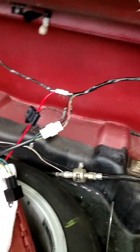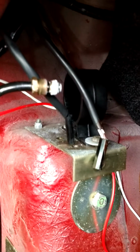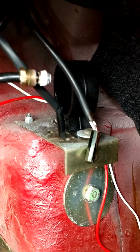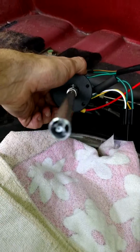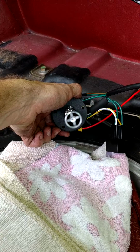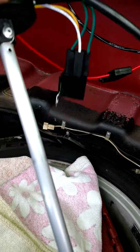Okay, inside, what did I do? I'm replacing the fuel filter at the time since it's all apart. The fuel pump is also going to get replaced with an SU original, taking out the old one that was an aftermarket. It was working, but I'm just taking it out. And then here's the new Centroid dip type sender. So it uses some type of capacitance measurement in the tube between the inner pipe and the outer pipe, measuring the fuel, how high it is on the tube.